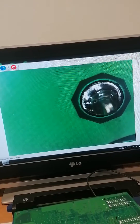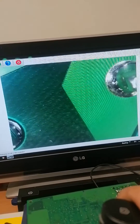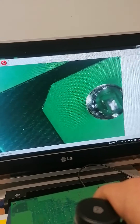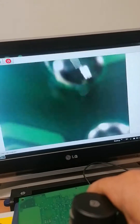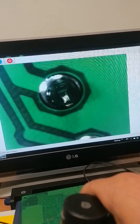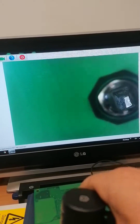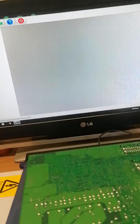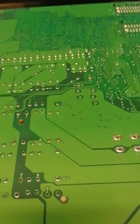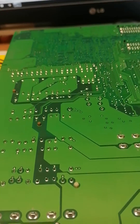Classic. So this whole board is going to have to be desoldered — look at that, it's everywhere — and reflowed. I would put in a second-hand BCM, but it's going to have to be reprogrammed, and chances are it will have the same problem. These are notorious for that, so just a heads up.